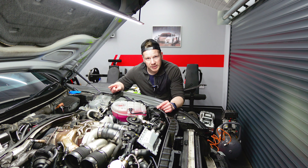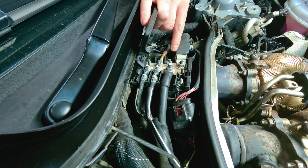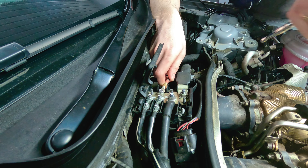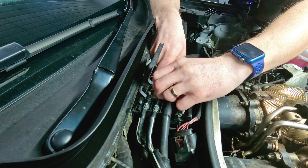Oh, it feels weird to be in there with the lights on. I hope we haven't buggered it up. I can hear the fan doing its thing in there. Just keep an eye on the coolant level - I might put a tiny bit more in now. That's been a couple of minutes now. I'm going to disconnect the battery and then I'll bring you around the front to see what comes out of that top heater matrix pipe.